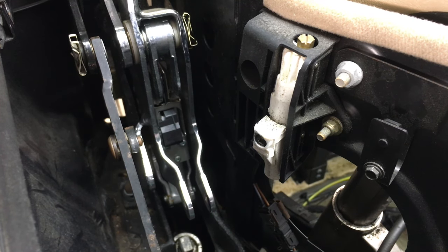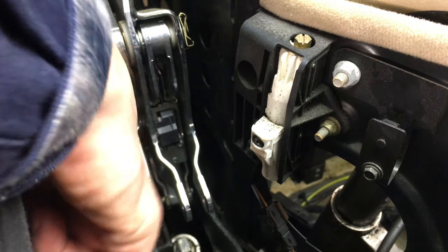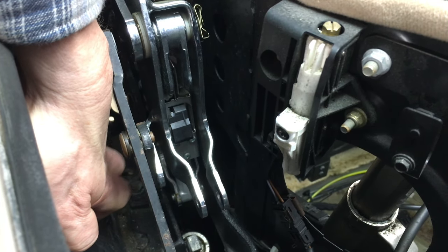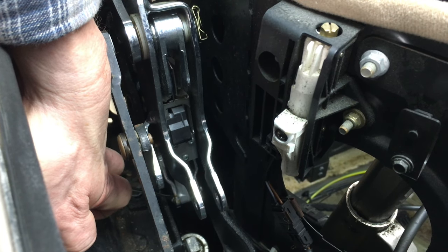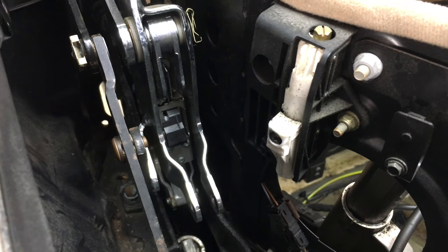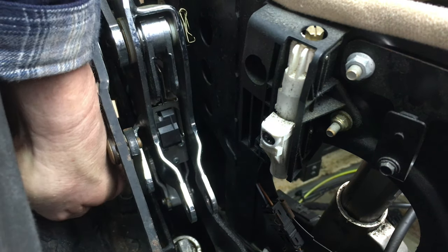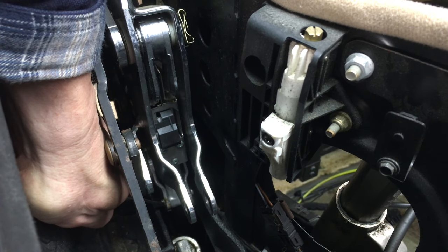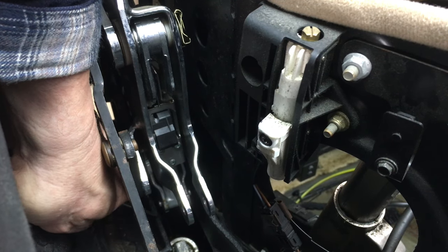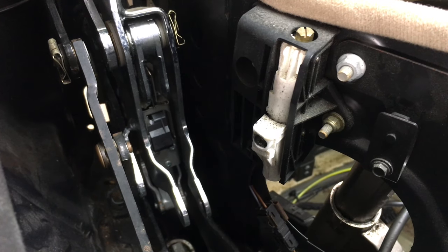In newer models we have to remove one of the circlips — the outer circlip that's barely visible in this video. We have to remove the outer circlip here in order to later pull the pin out once we have access to it. To remove this circlip, the top and rear bow must be up, and we keep turning the clip until we're able to hook a flat screwdriver into a gap. You're forgiven if this clip goes flying, because they go flying on me too.